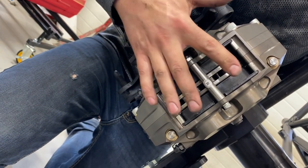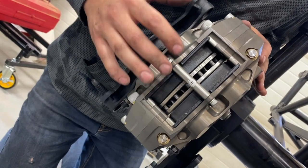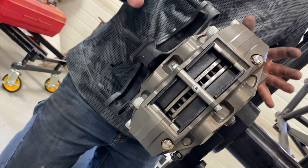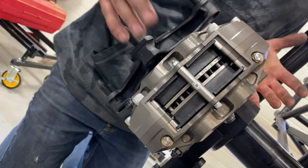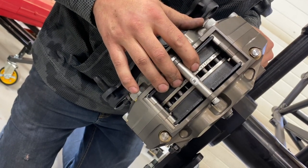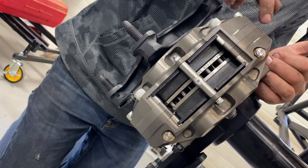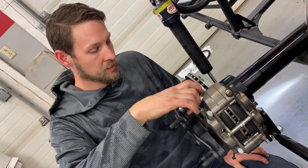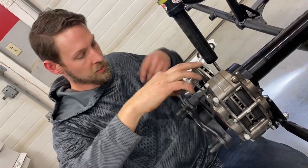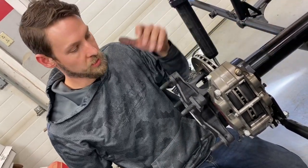Now you can see we have relatively even spacing on each side of the rotor to the pads, so with the pistons backed all the way up with new pads they won't be touching until you press the pedal, and the pistons will extend evenly as they wear. The top of the pad needs to be flush with the top of the rotor — this bracket got me perfect, no adjustment needed. If the rotor was sticking up just a little bit past the pad we'd put shims between the caliper and the dynamic bracket to space it out until it was flush. So now we remove the set screws, put the bleeders on top so they're ready to bleed, and hook up the brake line to the side.